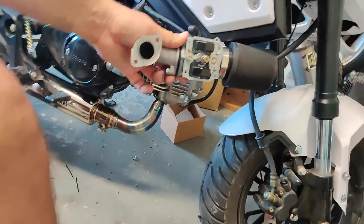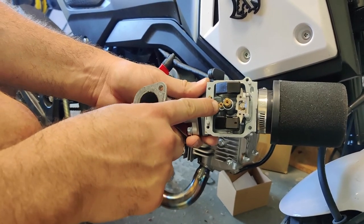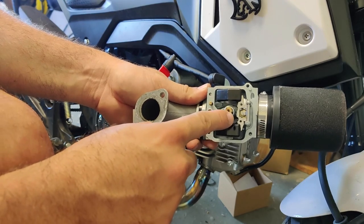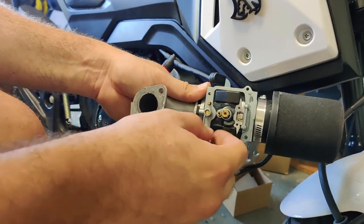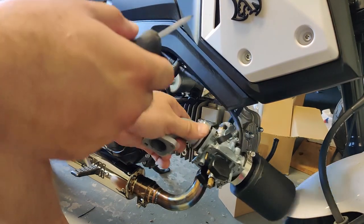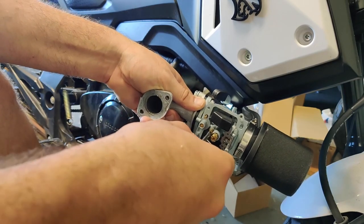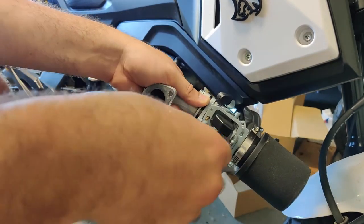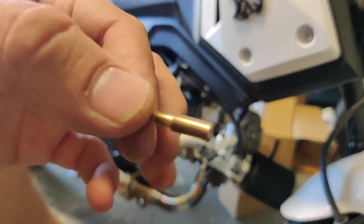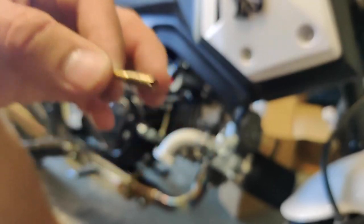Alright, so we've got the carb out. First thing I'm going to do is undo the bolts on the bottom to get access to the jetting inside. Here's your jetting right here — this is your pilot jet and this is your main jet. Remember, the pilot jet is your idle control and quarter throttle, and the main jet is basically quarter to full throttle based on how the needle jet is moving. Once fully opened at three-quarter to full throttle, it's all the main jet controlling your metering. Be careful when removing these because they're easy to damage being that they're brass — it's a softer metal. Here's a close-up on the main jet.